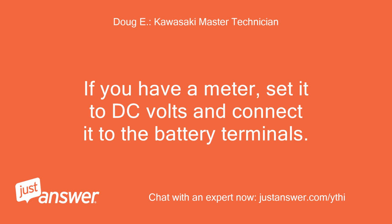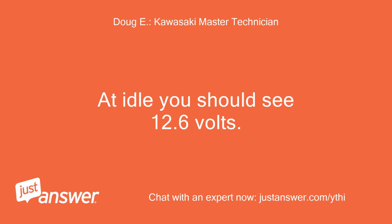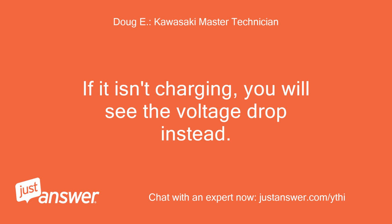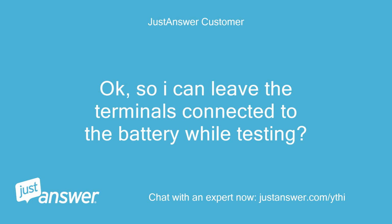If you have a meter, set it to DC volts and connect it to the battery terminals. At idle, you should see 12.6 volts. At full throttle, you should see 14.5 volts, max. If it isn't charging, you will see the voltage drop instead. Okay, so I can leave the terminals connected to the battery while testing? Yes.